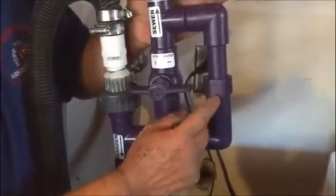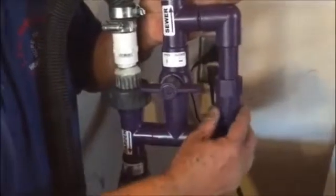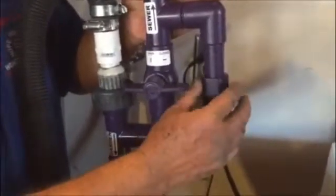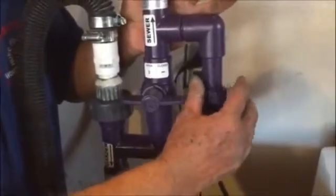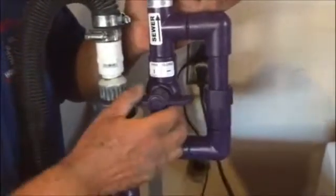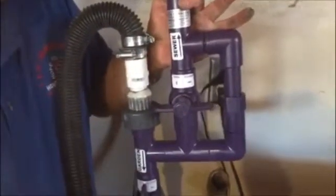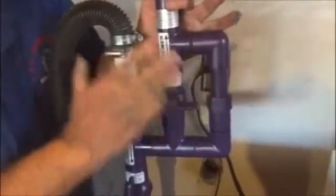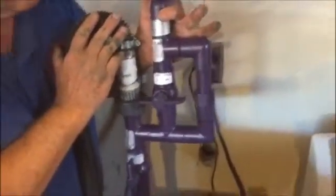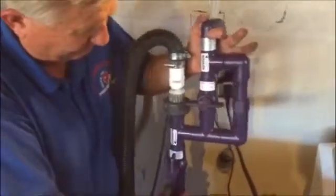This one here has a very good feature: a regulated emergency pressure relief valve. This is our own invention, calibrated to open at a precise four and a half pounds of pressure. That eliminates any possibility of back pressure backing up into the washing machine and causing damage or broken lines.